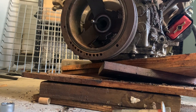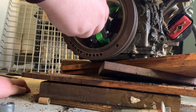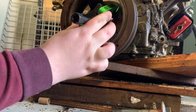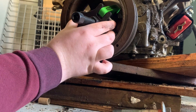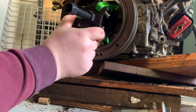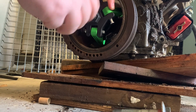You need the long one that your kit comes with. You stick the rod down into your motor, and there's a piece that the rod goes into. There's little tabs on the harmonic balancer — you're going to want your pulley to grab those tabs. You want all three tabs pulled. You might need to screw your bolt in more.